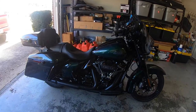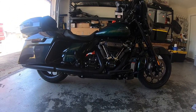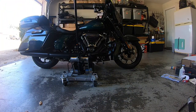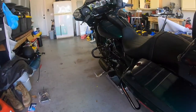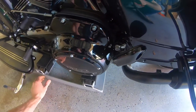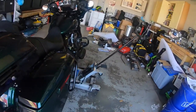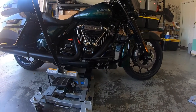Back with the bike backed up. We're going to move the jack, get it positioned underneath the bike, and start lifting it up. Checking the other side to make sure the little pads are all the way through — which they are. These are more than long enough; I can actually back it up a little bit, come about right there, make sure we have enough pad on both sides for the frame, and then we're going to start lifting.